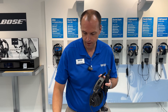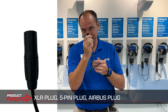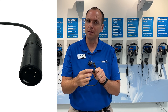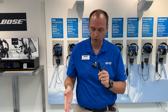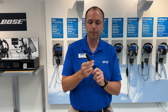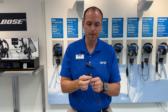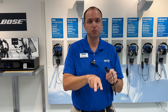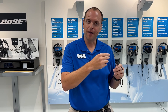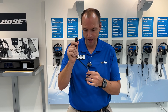The other panel-powered plug is the XLR plug. If you're familiar with karaoke microphones from 20 years ago, this looks exactly like the plug you'd find on those. There are five pins inside, so sometimes you'll hear people call this the five-pin plug, or it could also be called an Airbus plug — much like Bose was the early adopter for Lemo, Airbus was the early adopter for XLR. However, there are a lot of Boeing aircraft now with the same plug. Most of the time in aircraft with XLR or Lemo, the twin plugs will be right next to them, so if you have a twin plug headset you can still use all the avionics in that aircraft without needing XLR or Lemo.